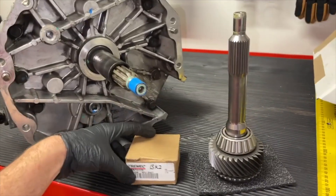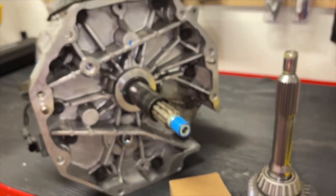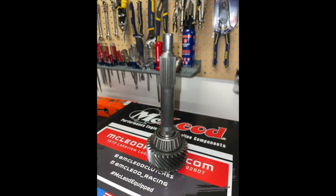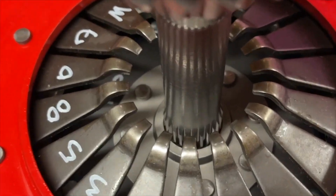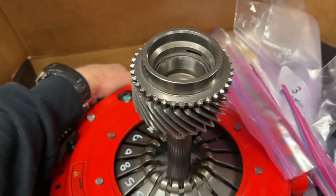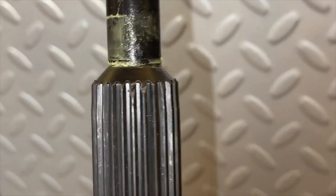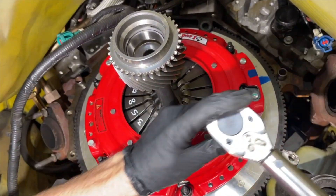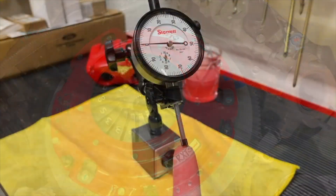With this upgrade you're also going to need to shim up the shaft, and I have a full video in the description on how that process is done. Typically you buy the shaft in a shim kit. Now you need this 26 spline input shaft so it will match the 26 spline clutch like this McLeod RXT. Tremec used to offer a shaft that worked for the 0304 Cobra — part number TUFM6132 — and you can also find it from Liberty Gear or D&D, but there was always controversy that it was just the Tremec shaft re-boxed. There was also talk that one company was actually using the GM shaft, just shortened or altered to fit the 0304 Cobra.